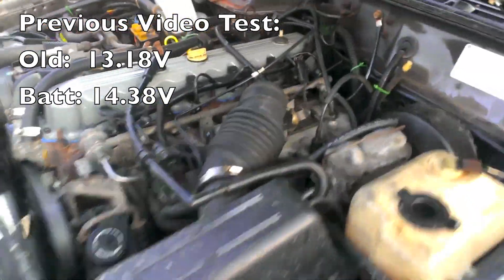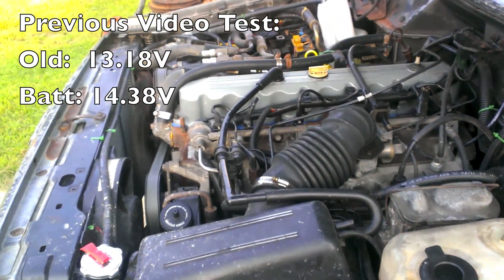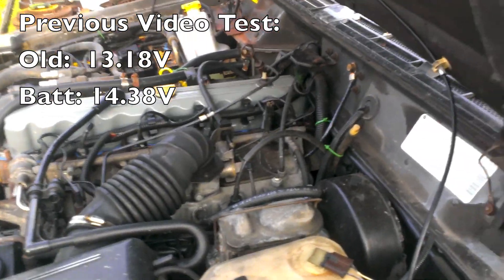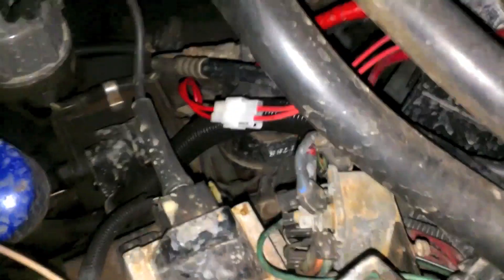Also, if you're wondering why I always do the voltage tests with the engine on, it's because that starts the alternator and boosts it from 12.5 to 14.5 volts, so you get a more accurate reading for when you're actually running. They're just going to sit there and I made that look a little nicer — I slipped the wires into that little wire harness. And I'm done.